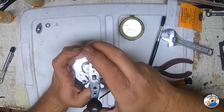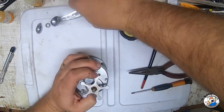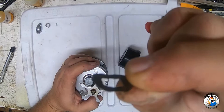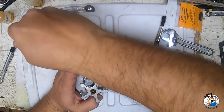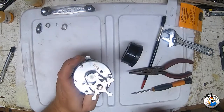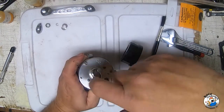We're going to lay that tiny snap ring right there, and then the handle comes off. On the back side of the handle is our tension washer - the star washer for the drag. I'll lay that right there. Notice I'm just laying everything off in the order that I'm taking it off. The next thing we're going to do is start backing off the drag star washer.